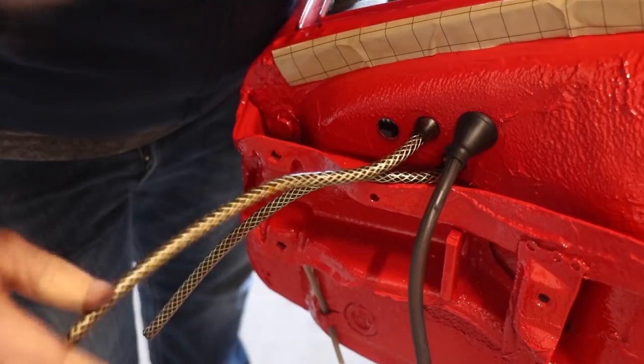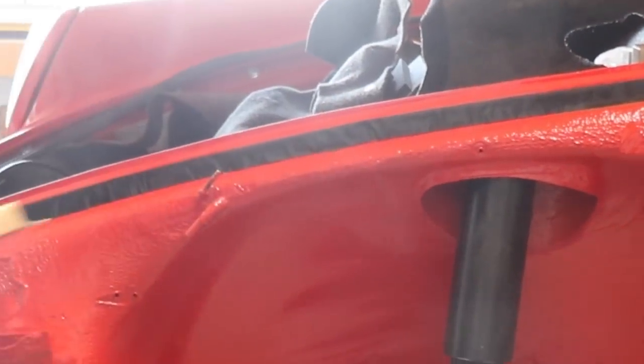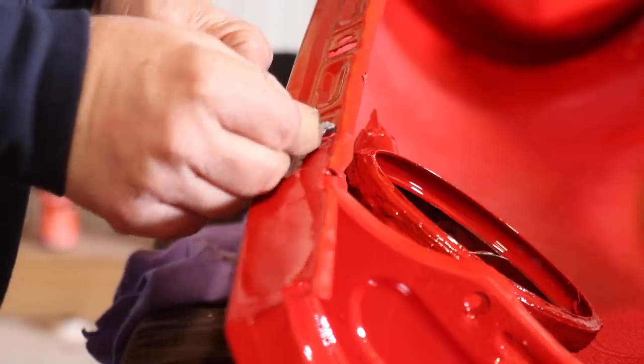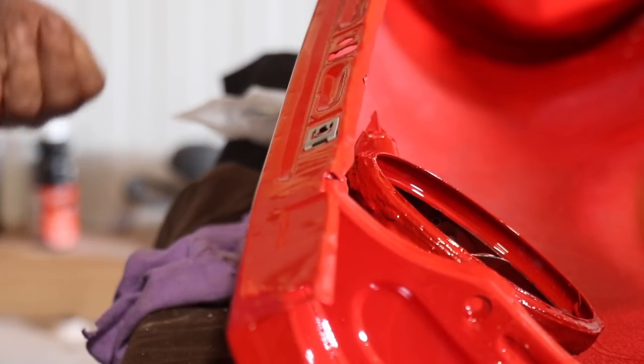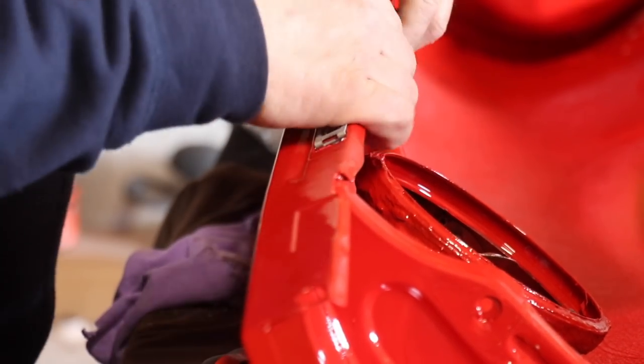The sealing tape I used is the usual traditional butyl material, which has been used for that purpose since the beginnings of car production. Once the fender is brought on, it will still allow some millimeters of play in order to get the gaps right. And believe it or not, these fenders actually fall in place without too many issues. I'll be showing that uncut in the coming minute.